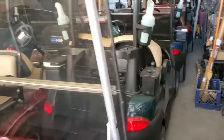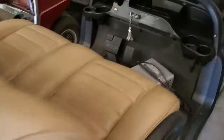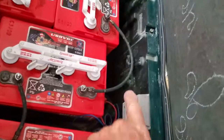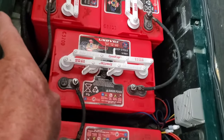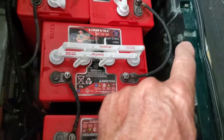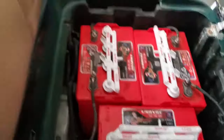On a Precedent you're not going to be able to see as easily, but it's the same deal. This is a newer one so the components are in the back, but the charge receptacle is down there. Same thing — you're going to go back there and cut those two wires, the black and the gray, pull them out, and reroute that black wire long enough to reach all the way over to your negative.